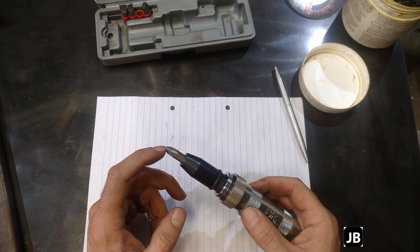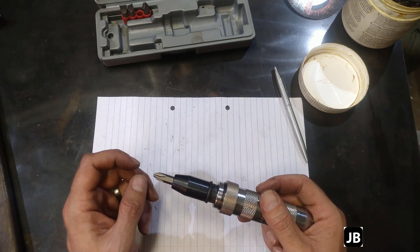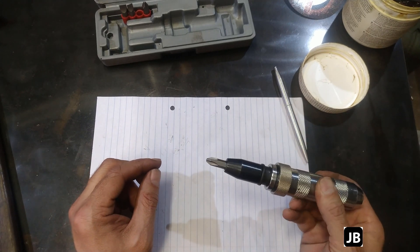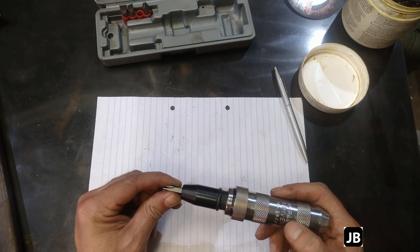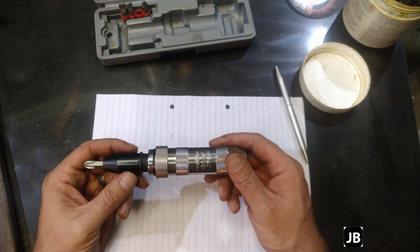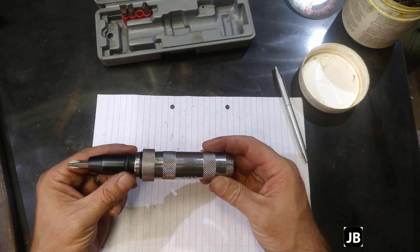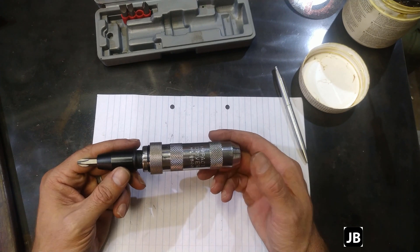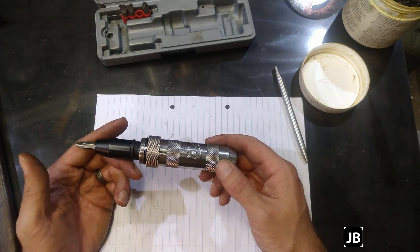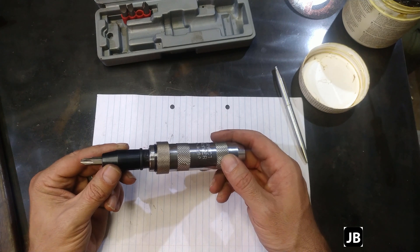A little tip: if your Phillips bit is not 100% and you're battling to get a grip on it, put some valve lapping compound on it. It works magic. Just dip it in the valve lapping compound and you'll be amazed. Gents, I think I'm going to wrap it up here. You need one of these — get one in your toolbox. You can buy them from all the usual suspects. Offshore brand, it doesn't have to be a name brand, and it'll save a lot of time. The $10 I paid for it saved me much, much more than that just in time, effort, and swearing. Thanks for watching — stay safe out there, guys.